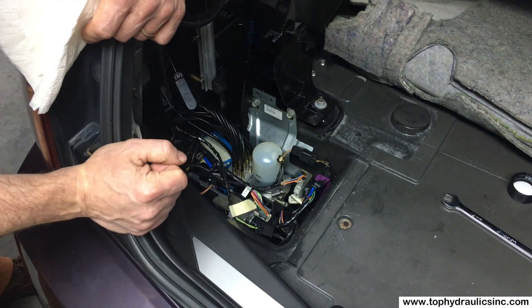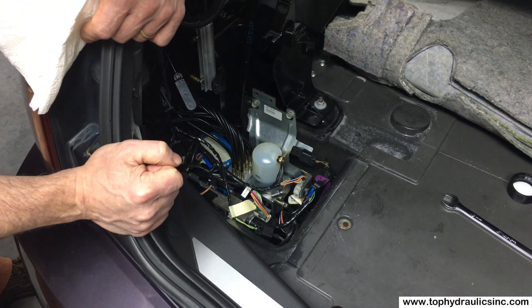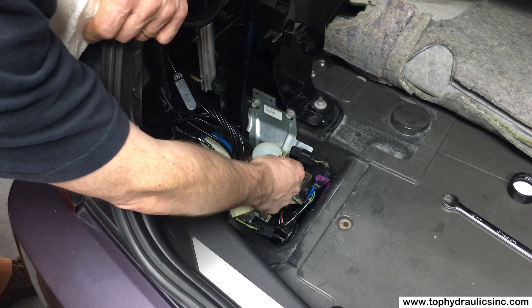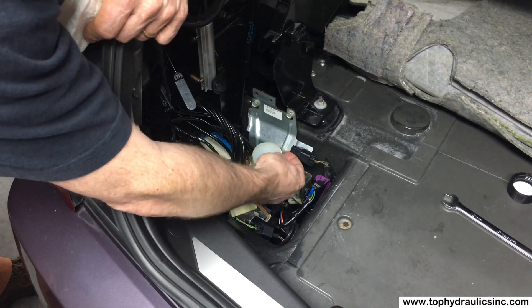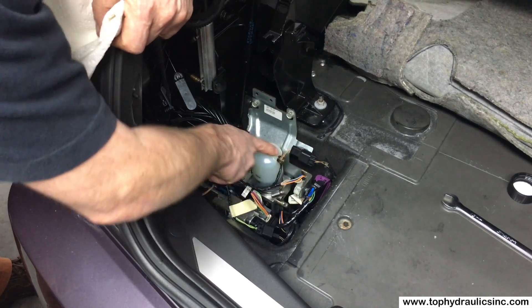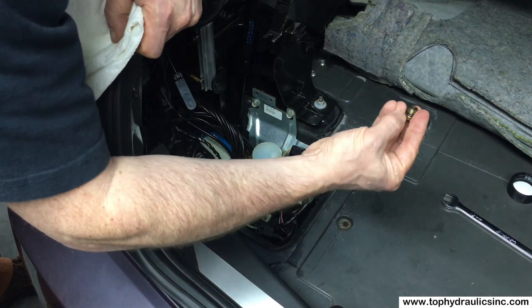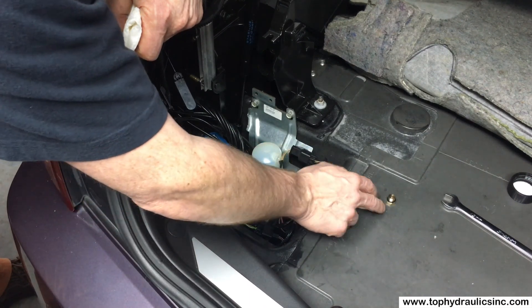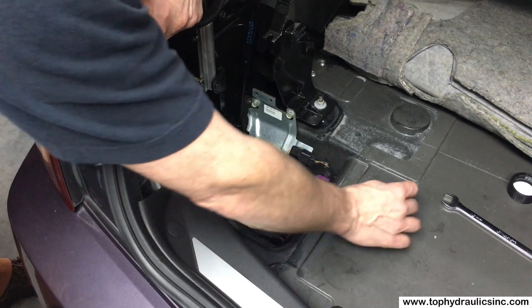Now that we have just replaced eight cylinders, we're going to apply a special trick: we overfill the reservoir, but don't fasten the fill screw all the way — we just thread it back in. The fill screw up here on the reservoir is a 13mm hex, and it has a little O-ring as a seal. Later on, when you tighten it, you want it just tight enough that the O-ring is in place.